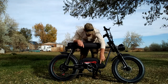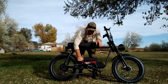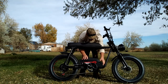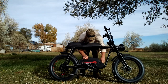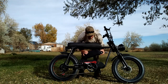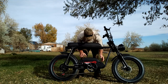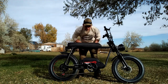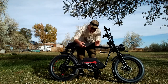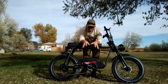They went further than that — they enclose the battery inside what I think is a cast aluminum box, hard metal on both sides. The battery can be taken out: unlock it with the included key, slide it forward, and lift it out to charge it, or you can charge it directly on the bike. That box will protect the battery from weeds, sticks, and rocks if you tip over — and batteries are expensive to replace.